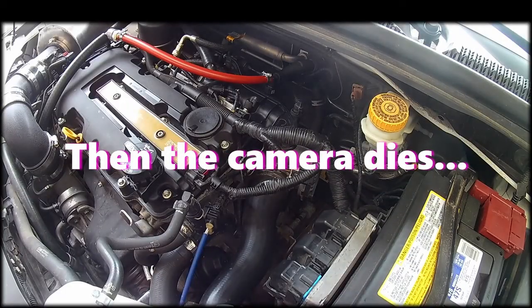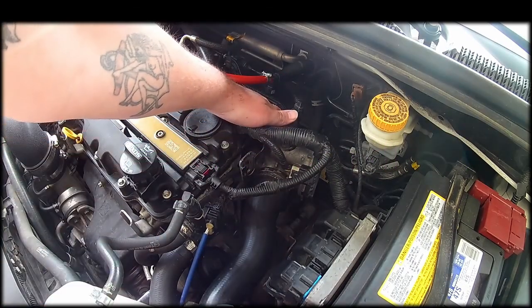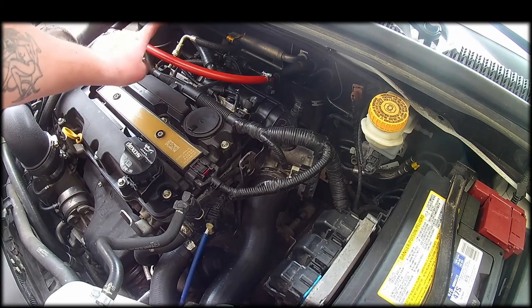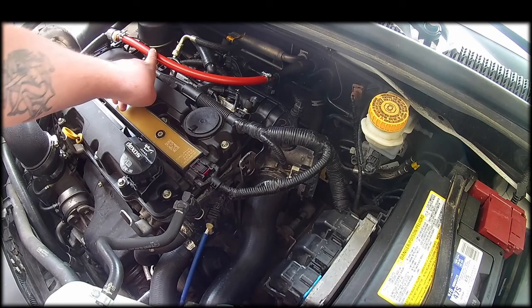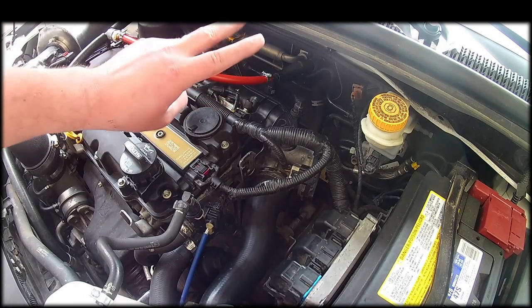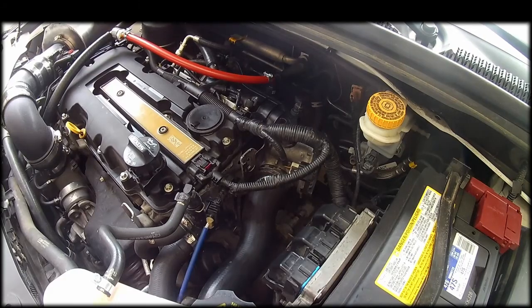So I had finished setting it all up pretty much, and I got my PCV Fix Kit version 2 going here. Basically just a T with the check valve. It runs off of the clean side of the catch can back into the brake booster vacuum. So here's first startup. And you can't really hear it, but she's holding vacuum pretty well.